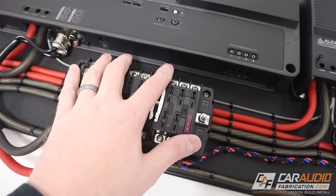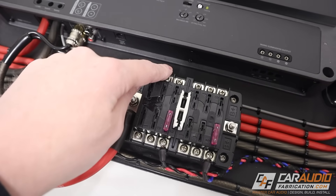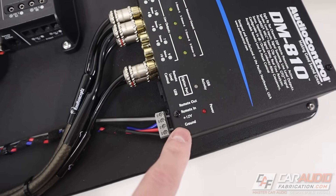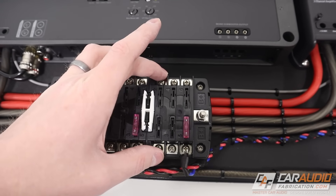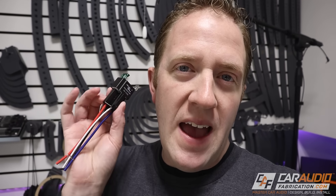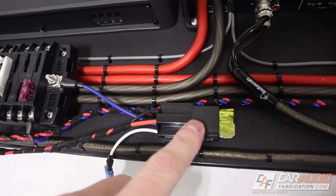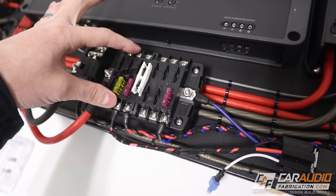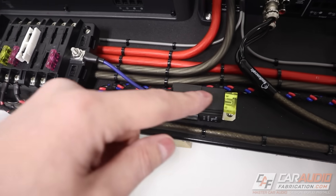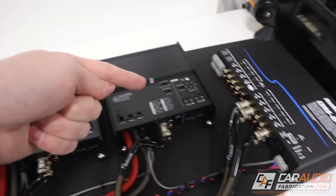We have our ground and power supply for this fuse block. The power supply here is hooked to a bank of six outgoing connections — all of these will be a 12-volt constant, which is what I use for my 12-volt constant on the DSP. There's also a totally separate bank of six more connections that I can use for switched-on leads. The normal turn-on lead from a head unit won't give enough current to power multiple accessories, so that's why we want to add a relay. I've added that relay — it's fed with a 12-volt constant from this side of the fuse block, and once activated by a remote turn-on lead it will deliver a 12-volt switched source with more current for accessories like LED lights, fans, and turning on the DSP and all the amps.